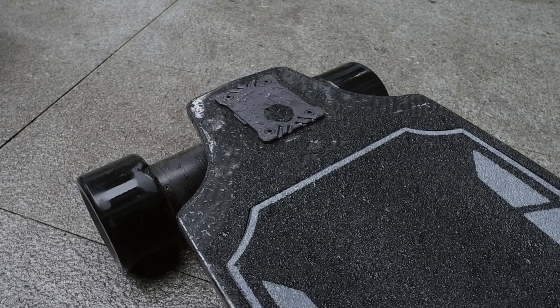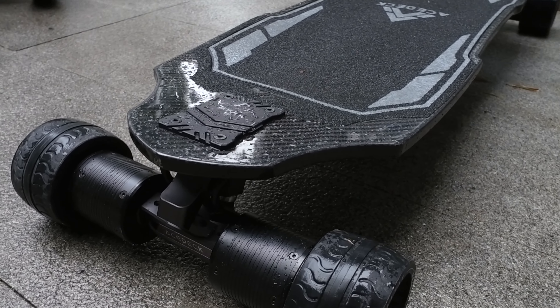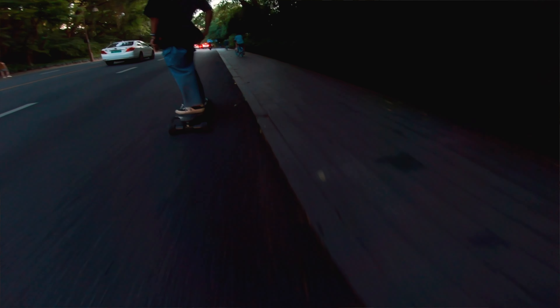That is definitely an upside of direct drive motors — one of the features I really liked. Recently we've reviewed quite a few hub boards, and on them you can't really change wheel options that easily, and there aren't that many options compared to regular e-skate wheels. So being able to switch between any wheel you want is very nice. And for heat dissipation, because these motors are on the outside, fresh air can take the heat away and they're not going to heat up as much as hub drive motors. The direct drive motors do have an outer sleeving which affects heat dissipation slightly, but not that much.